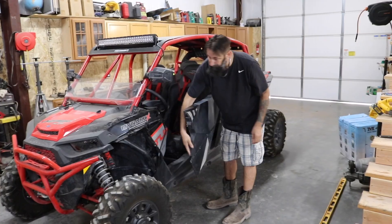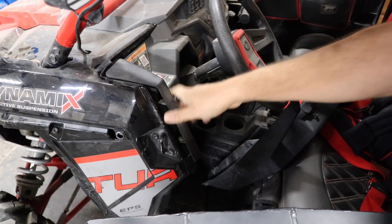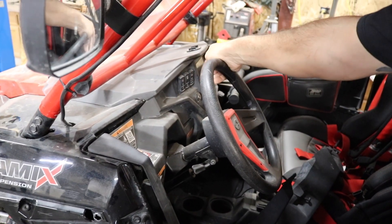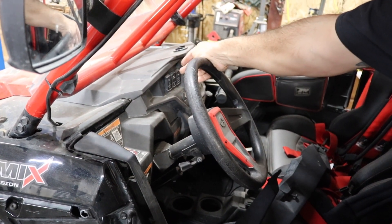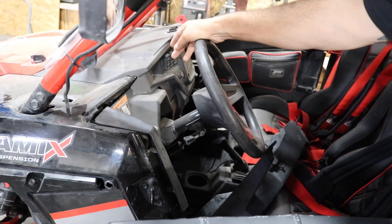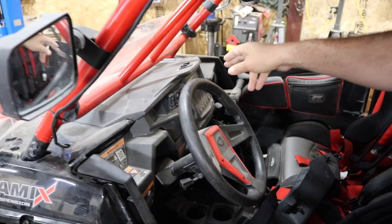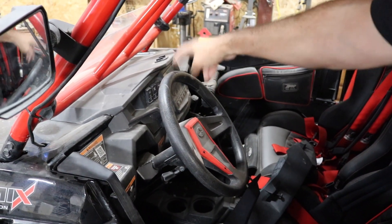The door skin — some of the rivets came out. On the dashboard, the dashboard popped out, and because it popped out, it came forward a little bit. There is a wire harness that connects to the firm/sport/comfort mode that also got disconnected. I know this because the shock light is on on the dash and the code points to that connection not being made.